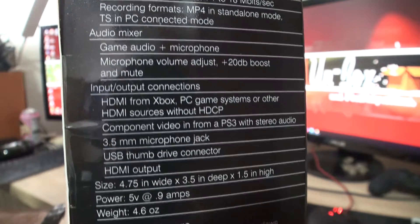Quick note: the covering letter in the box mentions problems users have brought up, like low audio volume in recordings. It says to plug it in and run a firmware update to solve this. Go to www.hauppauge.com/rocket to find the page. You can save the firmware file to a thumb drive and plug it into the Rocket, or plug the Rocket in via USB and update it directly from there.